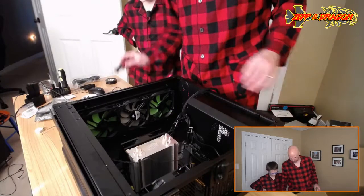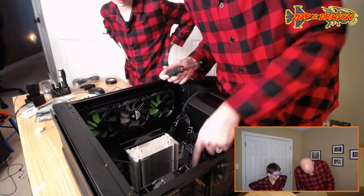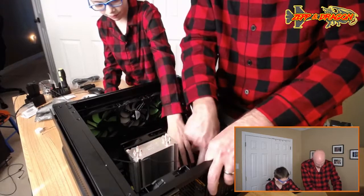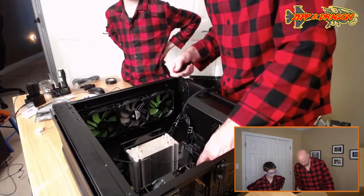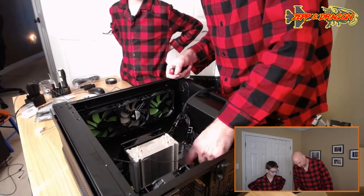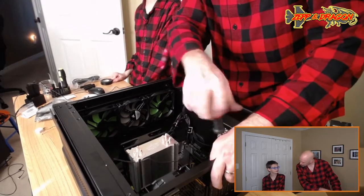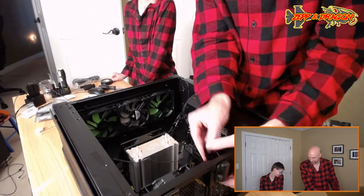Oh, my gosh. Okay, so because this is a double slot, see how it's got two there? We have to actually open up two slots. And it's going to be these two slots right here, so that this part right here, I'm just going to call it the yellow part, can slot into this part. Yeah, and see how this one's reinforced? Also, at least from what I understand, and I could be wrong, you want to put your main video card in the slot closest to the processor, because evidently that reduces a little bit of the communication time between the two components. Kind of makes sense. Probably reduces it by like 2 milliseconds, maybe? Probably even less than that. I think we're talking microseconds.